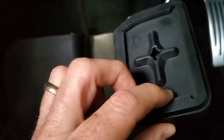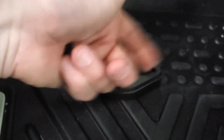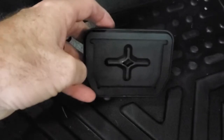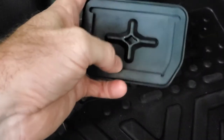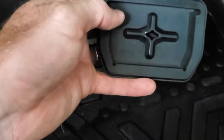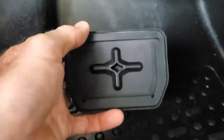Then I just had the sides left, with at least one side already started. I basically just walked that side up, prying as I went until it snapped into place. To recap: I got that top ridge hooked in first, then took my fingers on each side and lifted the bottom edge and a little bit of the side edge, forcing it down until the bottom edge was locked into place along with a little bit of each side edge. Then I walked up each side getting the rubber around it.